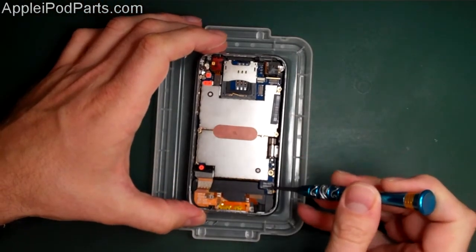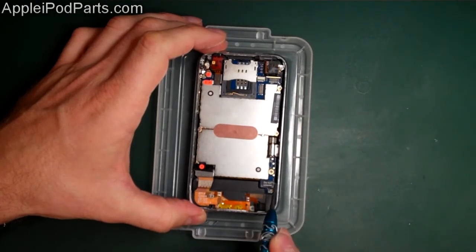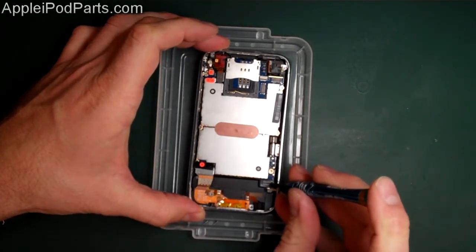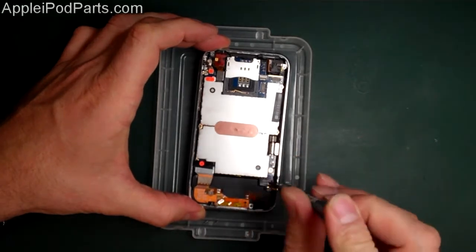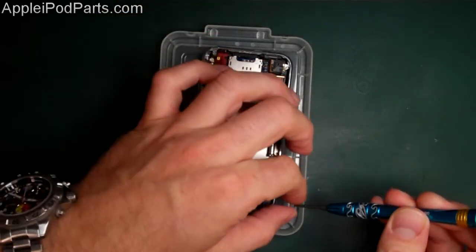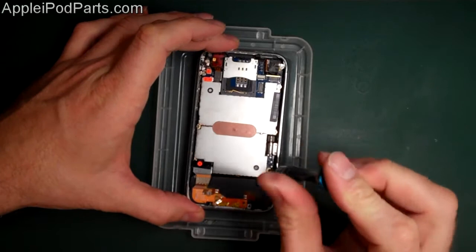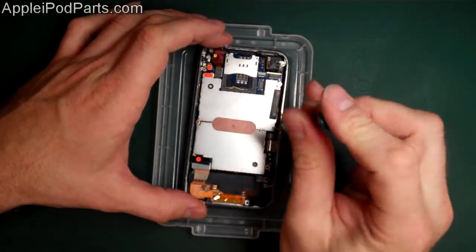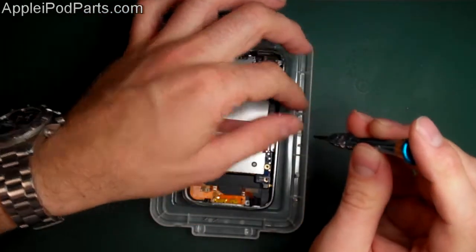You can see the screws down here. The 3GS has a little connector that comes up here with the aerial as well - you ping that connector off and you get to the screws. Now beneath this 'do not remove' label - that's the warranty label - is a screw, and I know roughly where it is, so we can go in there and undo the screw. Obviously removing this and breaking that seal invalidates any warranty. We're going to go round the screws one by one, dropping them in the compartments - it's quite useful because there are a few that are different sizes and we can keep them separate.